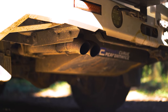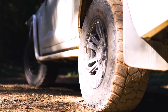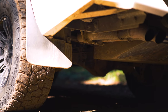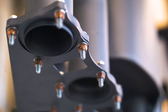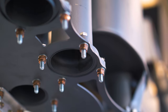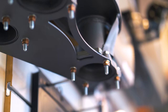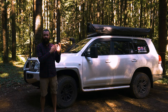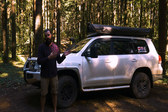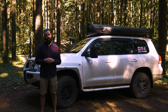On the other side of the engine I have a twin three inch Redback exhaust system. It took me a little while to work out what I wanted, but the twin three inch all the way through is what ultimately sold me. It's well priced, comes with a 10-year warranty, and the build quality underneath — with four bolt flanges all the way through — shows why. With three inches twin all the way through, this gives me effectively a three inch exhaust per bank of four cylinders and turbo, which I think is much better than the twin three into single four inch exhausts that a lot of people are selling these days.